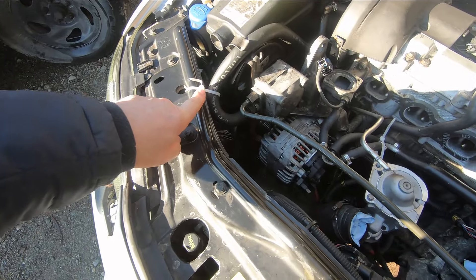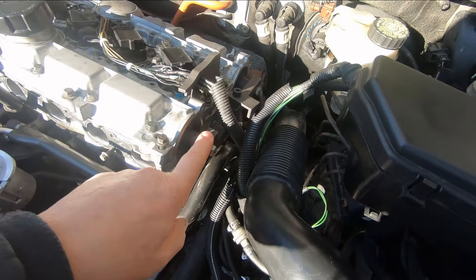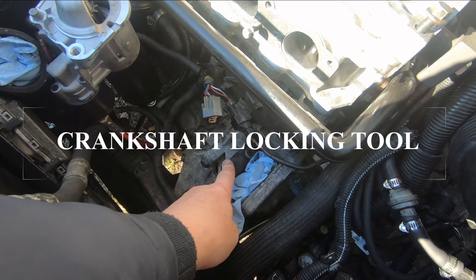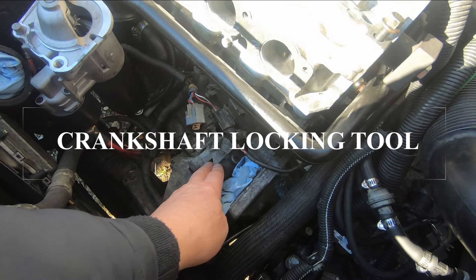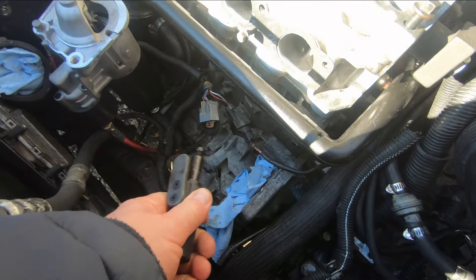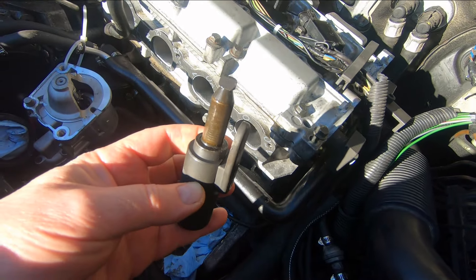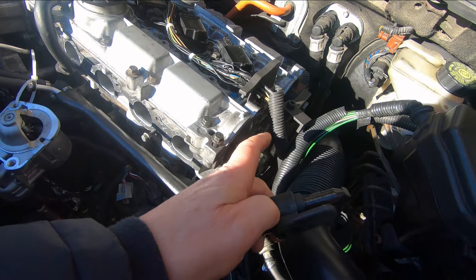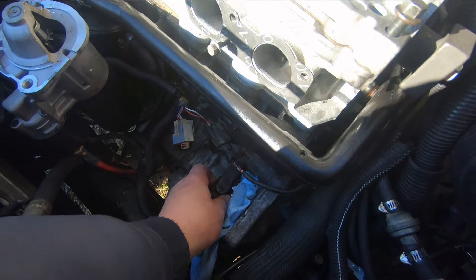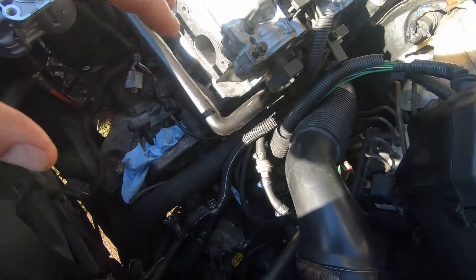I wonder why — and look here, look down here. You know what this is? That's a crankshaft lock. This is for setting the static timing. There's a plug, and there's a hole mounted behind the starter. This tool comes in a kit — there's a camshaft lock and a crank lock. When you put this in the hole, it goes in and bottoms out in there.